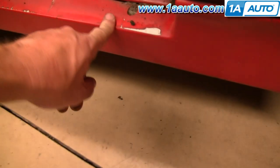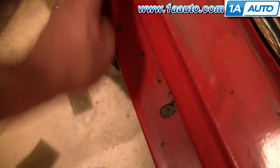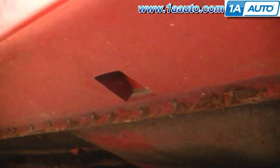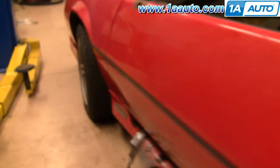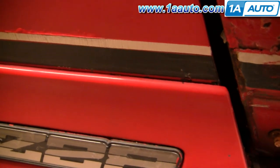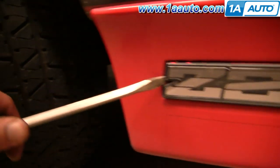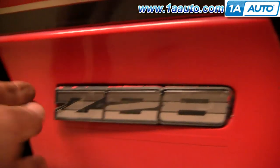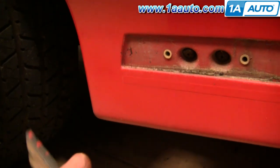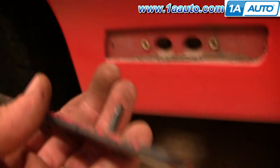Now that the doors are off, we can get these main side ground effects off. You can see there's a bunch of Phillips screws up on top, and I'll show you the best way to get those off. Underneath, there's a series of 9/32 bolts you need to remove. Hidden in behind — and you can see somebody actually taped off this Z28 emblem, there's no excuse for that — all this emblem does is just carefully pry it out and it actually just pulls out of the ground effect. It just has little locking nylon tabs, and it pulls right out. So no one should have any excuse for taping over that — it probably took them longer to tape it up than to just take it out.